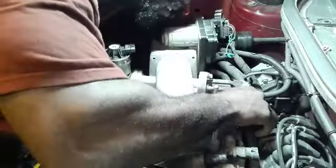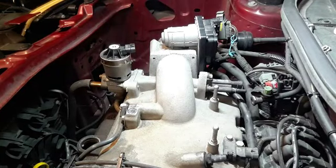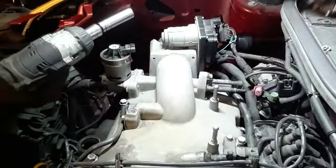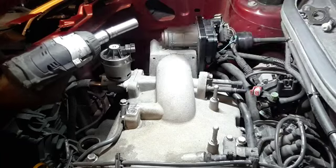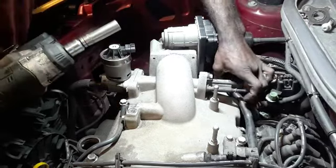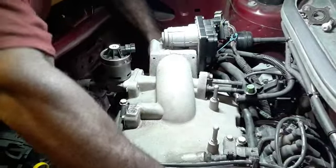It's gonna be a bolt for the alternator off. That's gonna look like a 13. About a half inch. We're gonna pull this. Watch these bolts out from the upper intake. God darn it. I'll leave a trail here. I'm able to put these back in some type of order. I'll worry about the tightening sequence when I get this done. Doesn't matter. It's my head gasket.